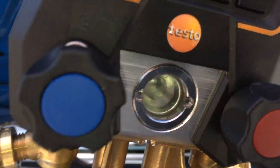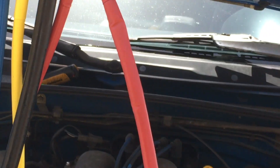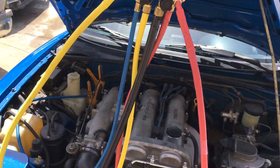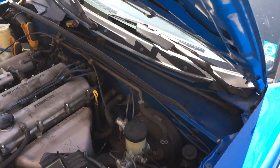Right now this will get the customer some working air conditioning. We didn't waste R12 in this vehicle because it would be a total waste to put R12 back into a vehicle like this. And remember — this is the vehicle that left debris contaminating the inside of my manifold. It was run low on refrigerant, which caused lack of oil return and lack of cooling, and the customer destroyed the AC compressor.